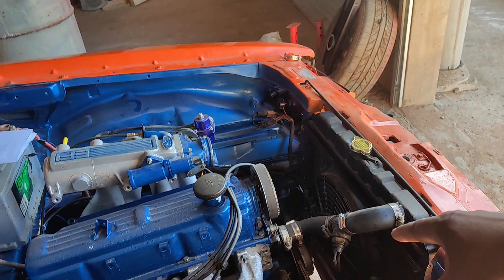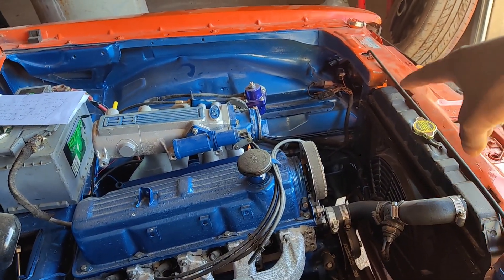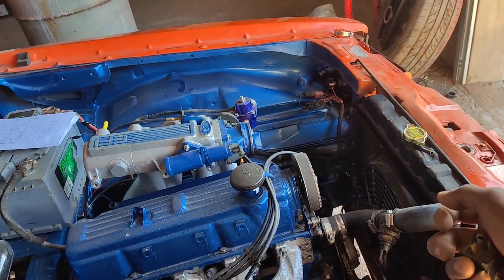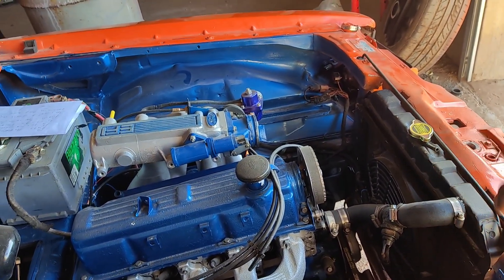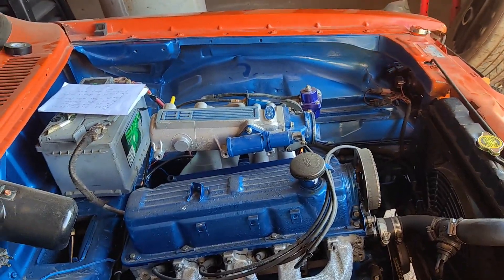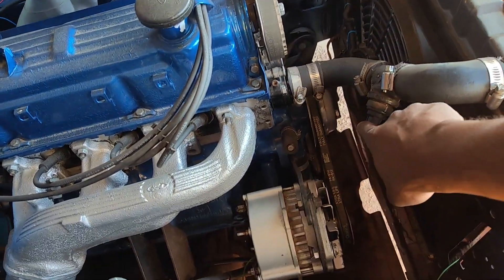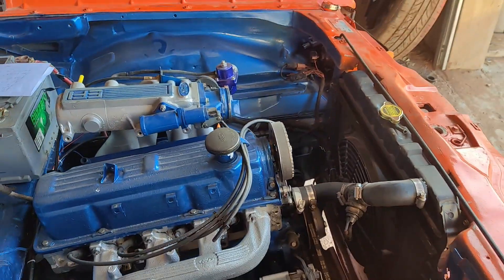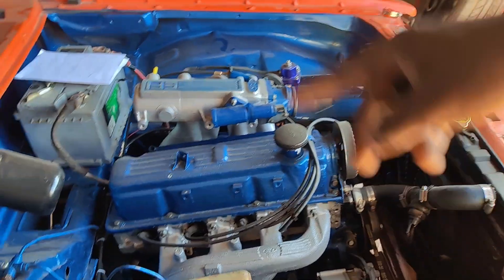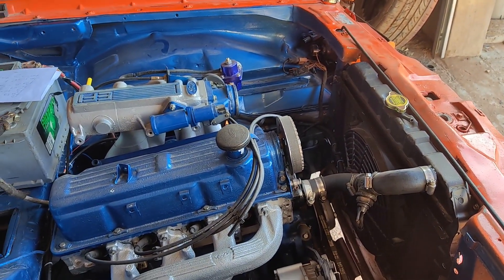Previously I just had one wire going to the fan, another wire going to ground, and one wire going to the battery from the fan. The temperature switch worked as a switch — one wire negative to the fan, the other wire positive going through the switch and back to the fan. That wasn't a nice setup because the load was on the wires and it would blow the fuse over time.